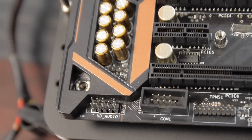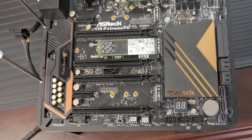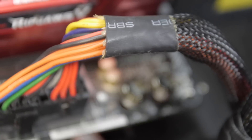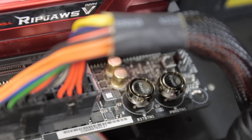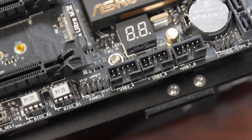There's also the front panel audio connector at the corner of the motherboard. You've got one Thunderbolt AIC connector with Thunderbolt support in the UEFI, though you'll need to buy a PCIe add-in card to expose the actual ports. There's one Dr. Debug LED output — two seven-segment LED displays that give you POST codes to help diagnose issues if the machine won't post. Near the ATX power connector, you've got a reset button and a power button, and the front panel header is at the lower bottom corner.